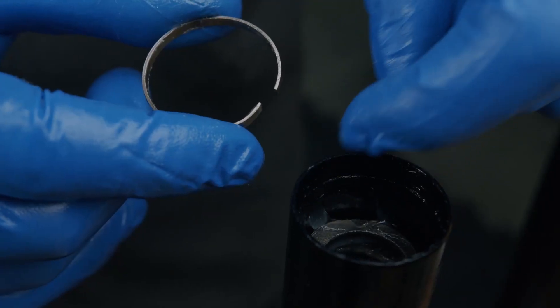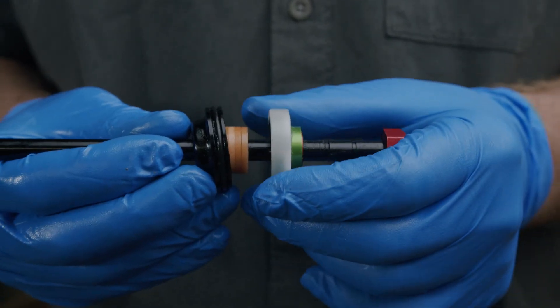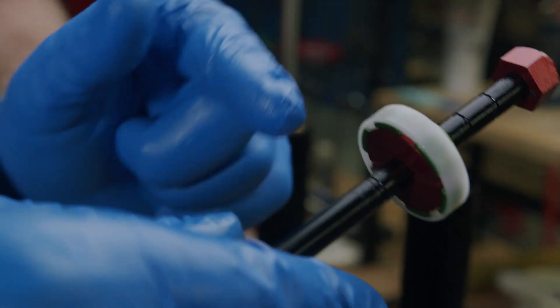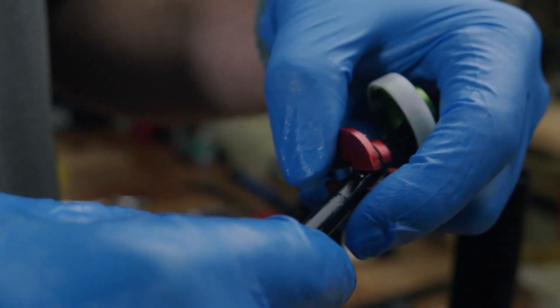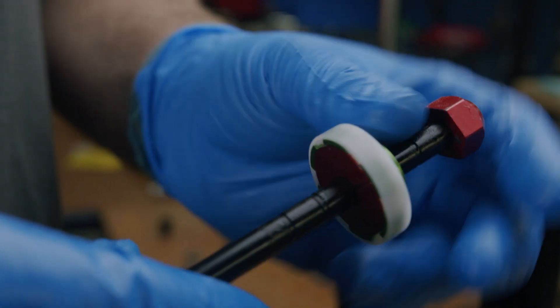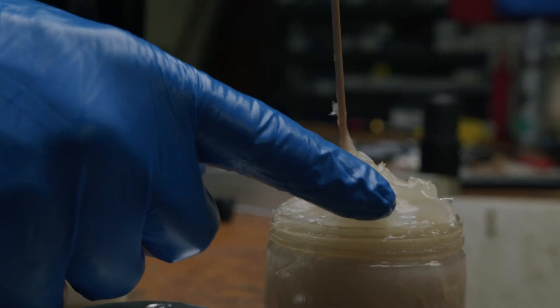Reinstalling this properly after your travel change has been made will be critical. The Helm coil can be travel adjusted between 160 and 130 millimeters of travel in 10 millimeter increments. Set your desired travel by moving the spring perch to one of the four grooves on the compression rod. Make sure the spring perch and the glide ring are properly connected together and greased before reinstalling.